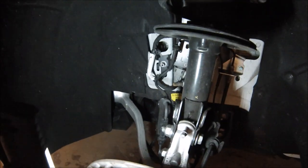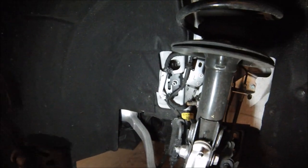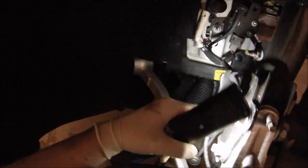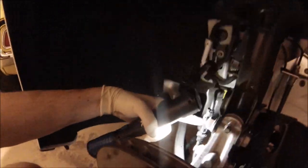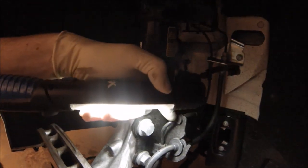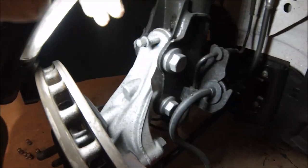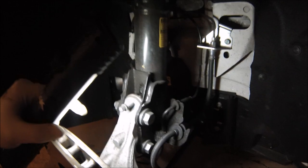We're going to start with the left front. First things first, get the car up, obviously. Take the tire off. Remove the wheel. And we're going to disconnect this connector, which looks like it just pulls up and then pops off. Basically you want to take all the connectors off of anything that's mounted to the shock tower or the shock itself — that connector on that side, which looks like the MagneRide, and then this is the brake line area: probably this is ABS and this is the brake line. Disconnect where you can and get everything out of the way.